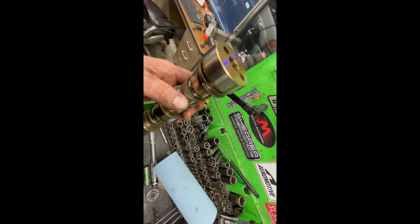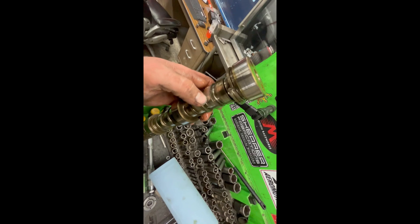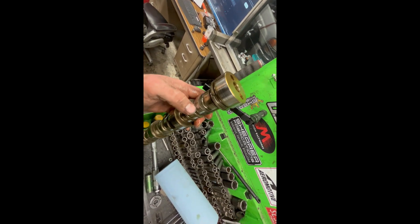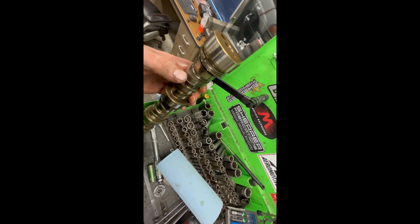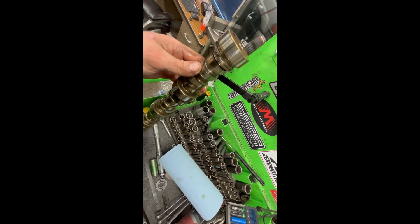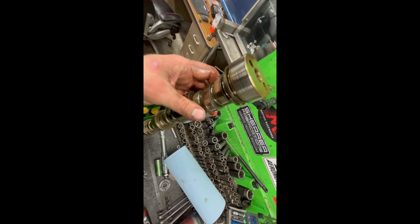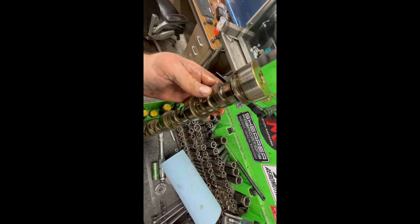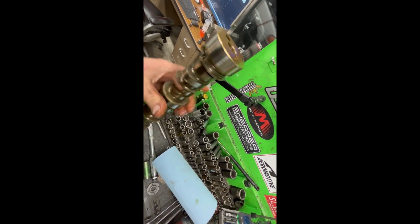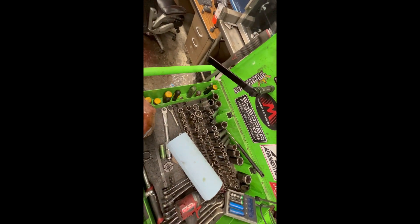You can really see that there - this was just starting to misfire. Your first noises might be subtle and the engine might be running fine; it may have to get to this stage before it starts misfiring and you can diagnose which cylinder it is. This is also why the customer thought it was a flex plate - it's in proximity to the rear of the motor and that's transmitted through harmonics back there. But we isolated this noise by removing those rockers. So: new camshaft and new lifters - that is the name of the game.